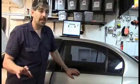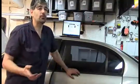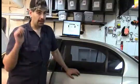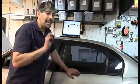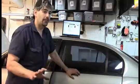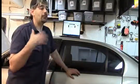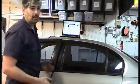If anybody tells you that you need to replace the air intake temperature sensor based on this code alone, and if you go to any of the common chat rooms for help, you're going to get tons of people that will tell you to replace your intake air temperature sensor. What I'm telling you right now is, if you change the air intake temperature sensor on this car based on that code, you're an idiot, even if it fixes the problem. There are a lot of people that just don't understand why that would be true, even if it fixes the problem. If that's the case, think long and hard about it. The reason is because there are other things that can cause that code besides the sensor. You have to test to make sure that the sensor is faulty. And of course, that's what we're going to do. So let me go ahead and get started up, and I'll give you a look at something.